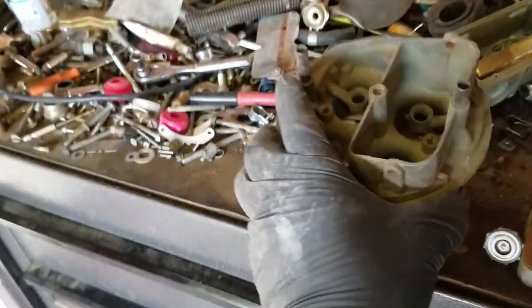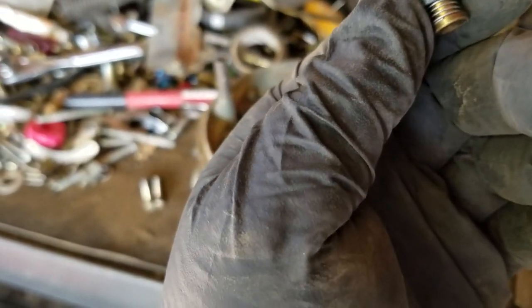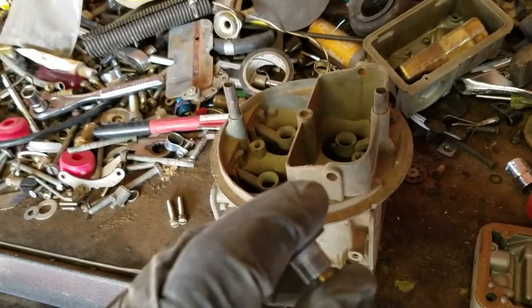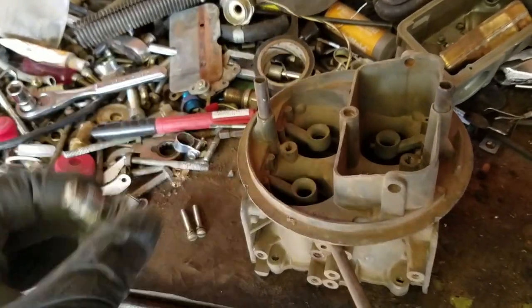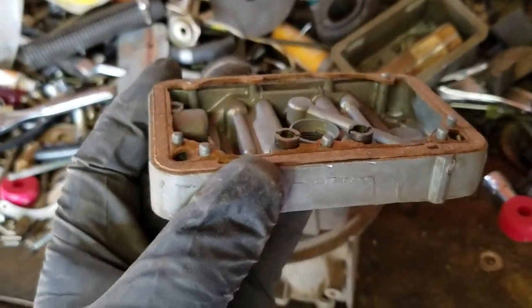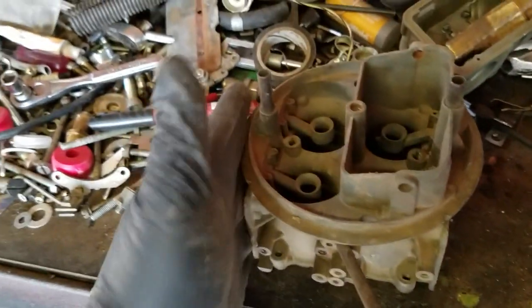There's nothing left in here except for the boosters. One thing I found odd — there's a couple of things — they've got this unmarked power valve in here, and it looks like it's got a double gasket. That's just a really thick gasket. Either way, I don't see any marks on this so I won't be able to use this power valve at all. It looks like it's still in good working order, but for now I can't use that. Next thing is I found that they had 76 jets in the primary metering block.